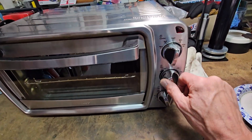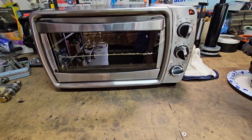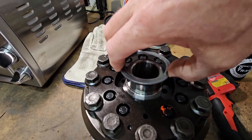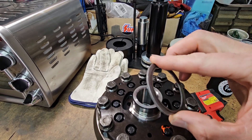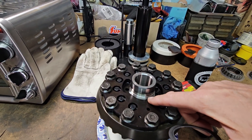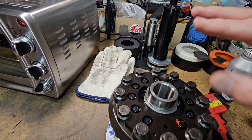Might as well start this oven up — 250 degrees. I have no idea how long it will take to reach that temperature. This is my differential, it's a new differential, limited slip, it's a Wavetrac. There is a shim on here and it's important to notice there's a bevel — it goes on one way. There's a bevel on that surface and you want that because this is beveled also. So bevel side down. Everything's been cleaned and inspected, and that's ready.